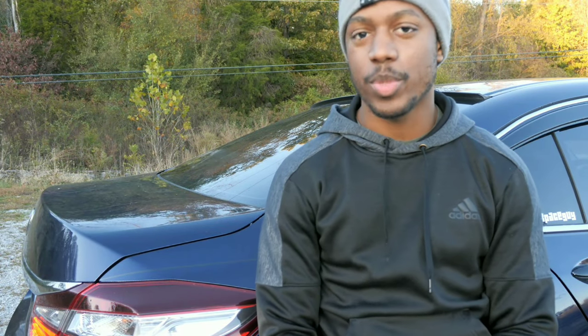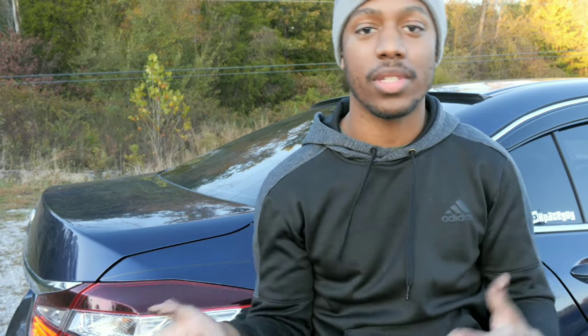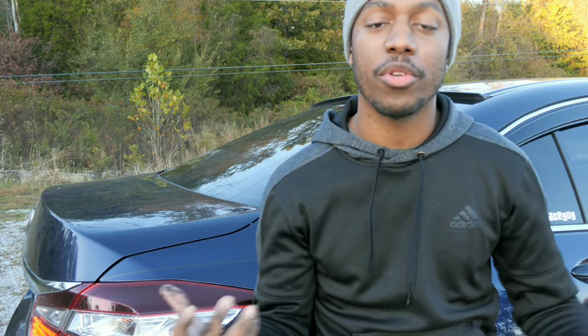Alright guys, so we got it sprayed in, we played the song, and to be honest the difference is very minimal — and that was an entire can of spray just on that trunk section. It made a difference — a little bit less rattle at the same volume — but it's not going to completely kill it. I still think Dynamat would do better. I'm probably going to Dynamat on top of it. Maybe if I put another coat or two of Boom Mat it might be better, but with just one can you may want to think about getting two or three — spray it, let it dry, spray again, maybe do one more coat. But Dynamat is still superior because you can control how thick you want it.